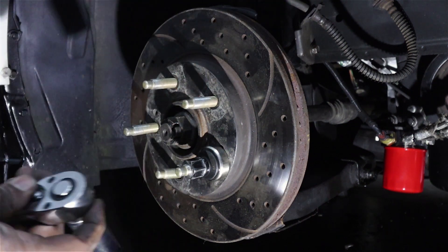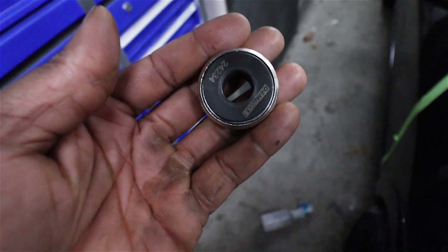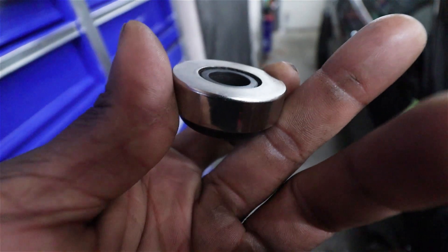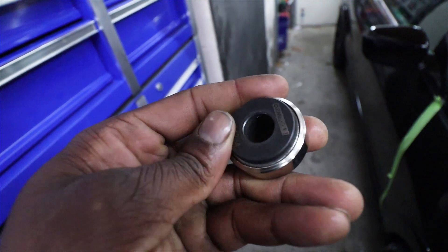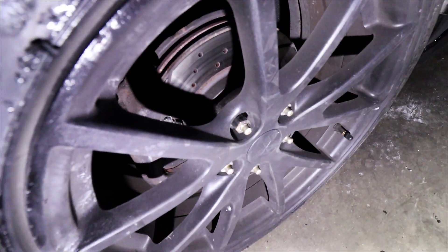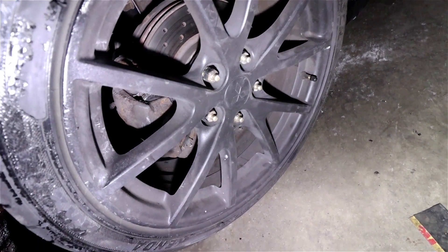This spins to keep the rest of it from spinning. Then just remove the tool and do that nine more times. Up close you can see the black piece spins independently of the silver piece — as you tighten the lug, the black piece spins, while the silver piece is planted against the rotor, which pulls the wheel stud through. This is the final product. I did have to cut the ends off all of my lugs because even with the spacer the studs are still too long, so I have some makeshift open-ended lugs. I may get real ones at some point but it's not high on my priority list.